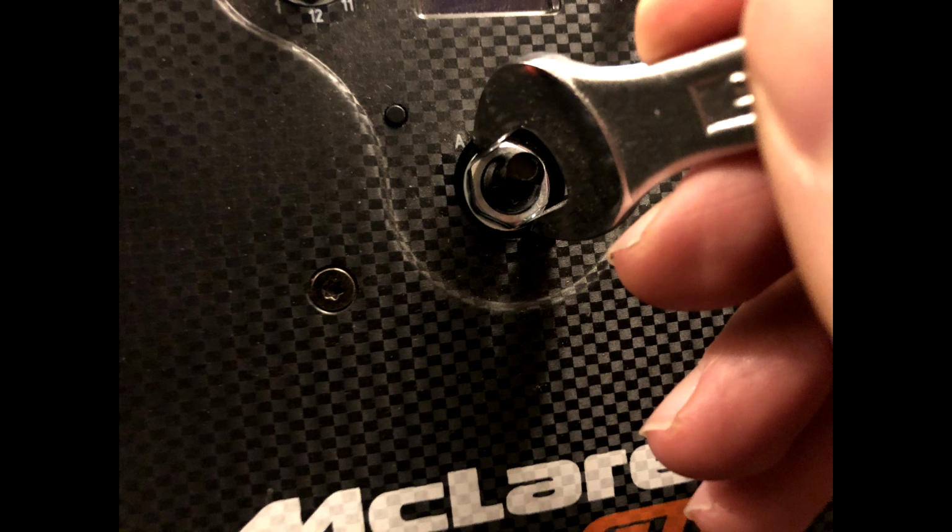I brought a 13mm deep socket home with me from work to undo the nuts which hold the faceplate to the mode switch and multi-position switches, but it was too thick-walled to fit in the gap. So if you're getting one to do this job, then a cheap thin-walled one is probably better than a hefty good quality one. In the event, there was enough room to improvise with a spanner.